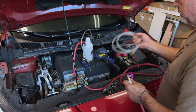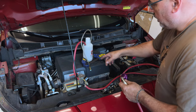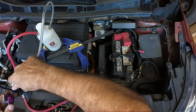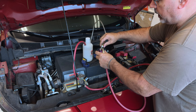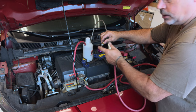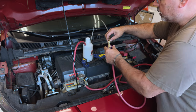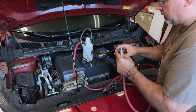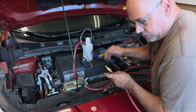There's also one for Audi and Volkswagen, which is a screw-on type cap. There is a quick release here — you put this on your master cylinder and engage the quick release. This is really easy to not have properly connected, so you want to pull the collar back and push it all the way in. If it's not properly connected, you won't get any pressure through it and you'll be trying to figure out why nothing's coming out of your bleed nipples.